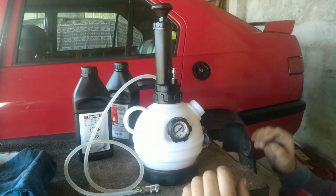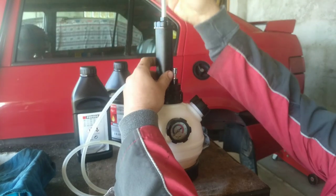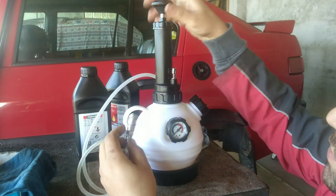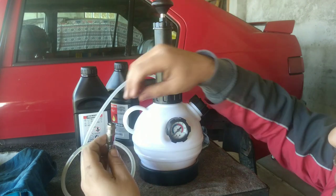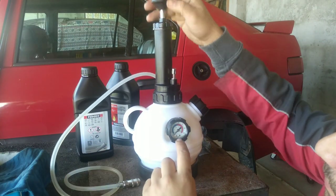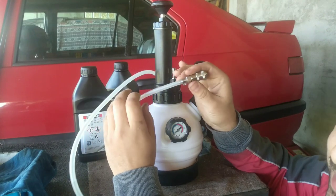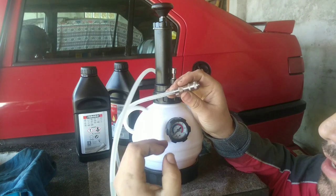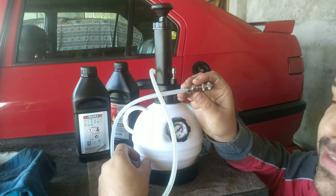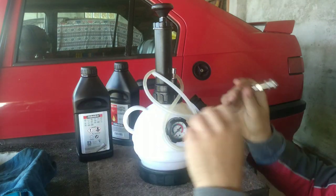Unless you use it every day, you should remove all the fluid inside your machine when done. Now I have the fluid in here — I'll cap this hole again and make sure it is tight. On the pump, this final component has a valve for the oil not to escape as you pump. As you pump, pressure starts to build up, and you will have a constant, air-free oil pressure through your entire system. If any air bubble passes to your purge, you'll know there's air in the system — it is very reliable.